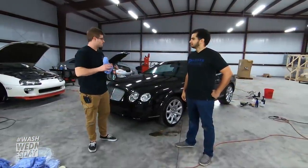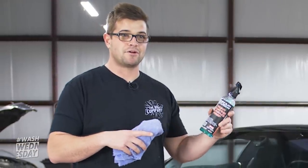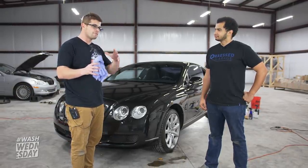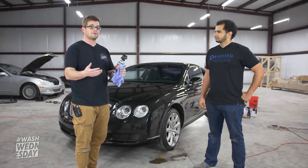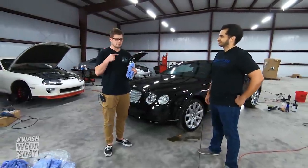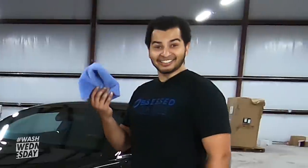Oh yeah. So we're in the last final steps of this. All we're going to be doing is a paint coating surface prep. This is going to prep the surface, removing all the extra oils and polish oils and things like that from the polish that we are using. It's also going to prep us for our protectant. So this is going to allow our polymer sealant to stick. Oh yeah. We want it to stick, we want it to last. So this is what we're going to do first. You got a towel? Now you do. All right. I got a towel. Let's do it.